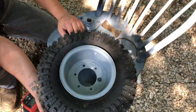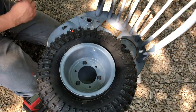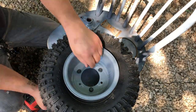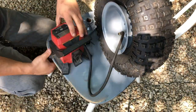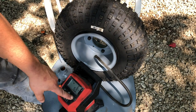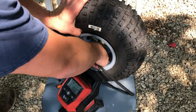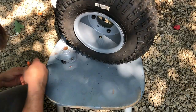I thought I'd use a tube for the center of the rim — don't use a tube in this application, and I'll show you why. We got the wheels bolted together finger-tight so as not to damage the paint. We screwed the Milwaukee air compressor to it and watched what happened. The problem is that no matter how big that tube gets, it is not wide enough to fully seat these tires. On a little lawn mower it might be fine, but on my boy's machine I'm just not going to let it happen.